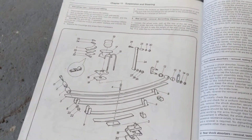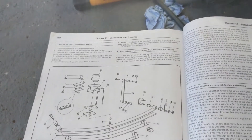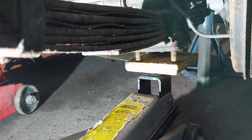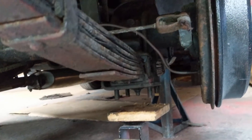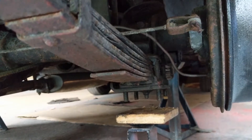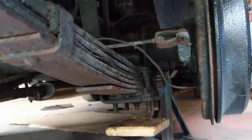We must have some weight on there, so I'm going to spray it really well and cover it with penetrating fluid and leave it overnight. It's the next day — we've had no movement here. I've seen a YouTube video from Rust Hunter where he had the springs off on the bench but basically needed to use a crowbar to get it all separated. We're going to try that now. With a little bit of help, we've got it all off.